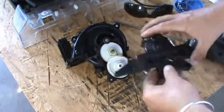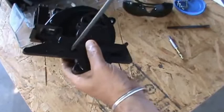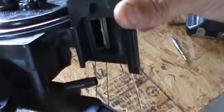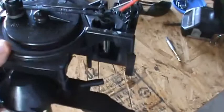We'll carefully line things up and try to get it back together. One other thing to look at is there's a spring-loaded butterfly gate here — you want to make sure that this mechanism is moving nicely and easily. What I'm going to do is lube up the bottom and the top of that butterfly gate, as well as the mechanism up top.